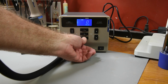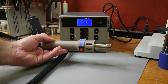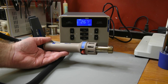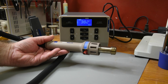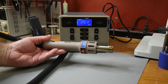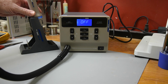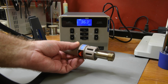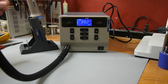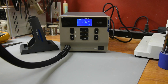The seventh entry is the standby mode. It defaults to off and can be set from 1 minute to 10 minutes. When the standby mode is enabled, lifting the handpiece from the holder within the set standby time will turn it on automatically. The standby time appears to be counted from any off state — placing the handpiece in the holder, using the button on the handpiece, or time expiring on the fixed runtime mode. This is a very convenient setting to have turned on if using it a lot.